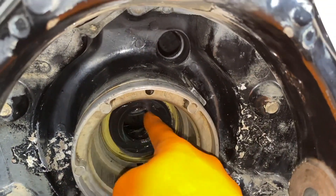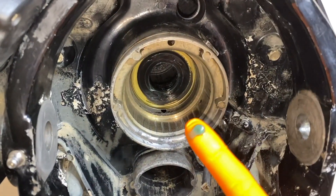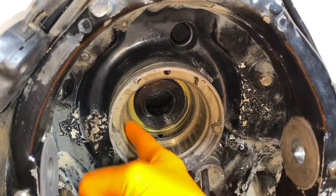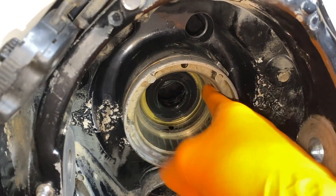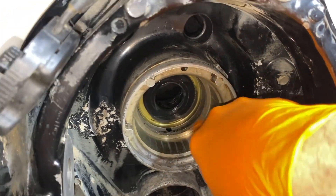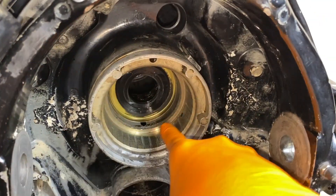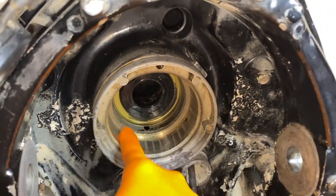The front side and inner portion that the yoke shaft slides into and rotates in. Some people do this, some people don't — I'm grabbing just a tiny bit of grease and I'm going to grease the inner housing that the new gimbal bearing will go into. This is going to help it shift inside this cavity or housing just a bit easier. Do not overdo this because your new gimbal bearing does not require grease.